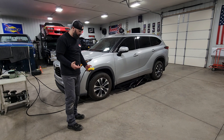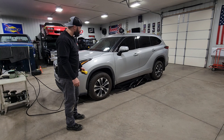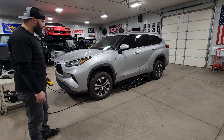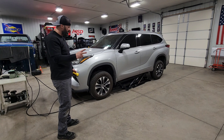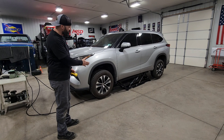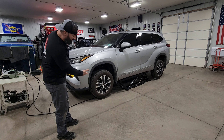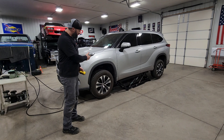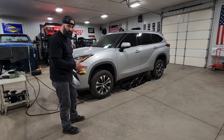I'm going to get these under the car — I have them pretty much ready to go with the pinch weld pucks on the QuickJacks. Basically it's just line them up and raise the car. The nice thing is the cord for the remote is pretty long, so you can work your way over while raising the car and make sure everything is lined up.